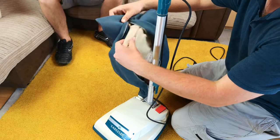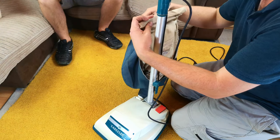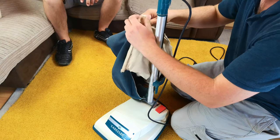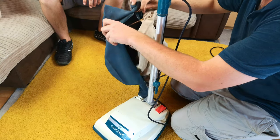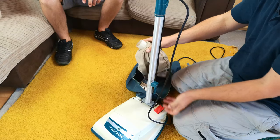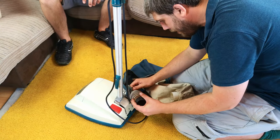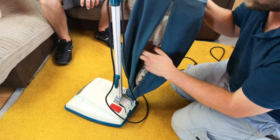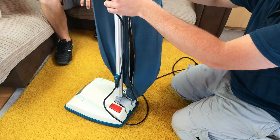Inside we have an inner cloth bag, which apparently has reuse instructions — but we haven't got those, so we're just going to have to wing it. It's got a very convoluted bag-holding system on it and all of this undoes. I won't undo it now because it is quite dirty. I've never been a fan of internal cloth bags. I'd say you'd be far better off just popping it out of the bellows — like so — and possibly just cable-tying a HEPA filter to it and never touching it again. The bellows seem okay, which is good.